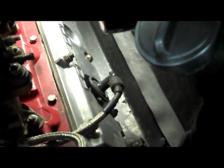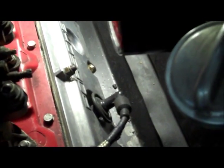The final oil leak is in the cylinder heads, just a slight seepage, so you're going to have to remove all 4 valve covers. So the intake valve covers are up here. You're going to have to remove the spark plug wires, and then there are 6 bolts per upper valve cover. And then we move down to the lower side here. The lower valve cover's got a lot more bolts, so you're going to have to take off all those nuts and then remove the lower valve covers.